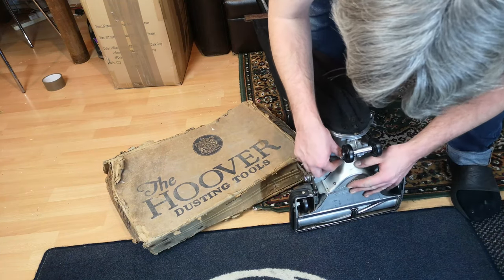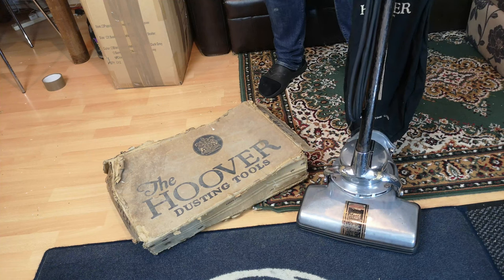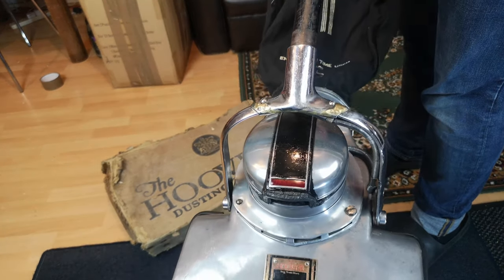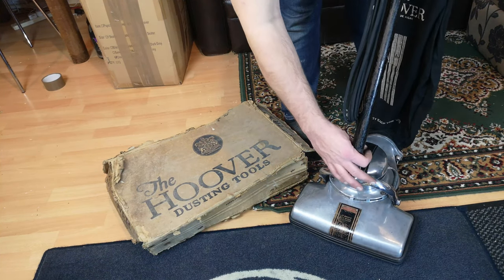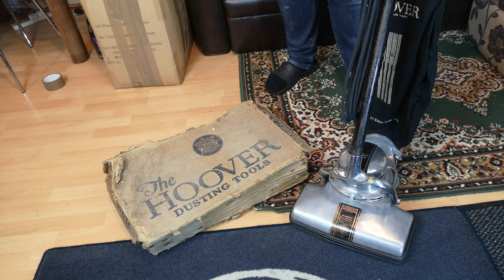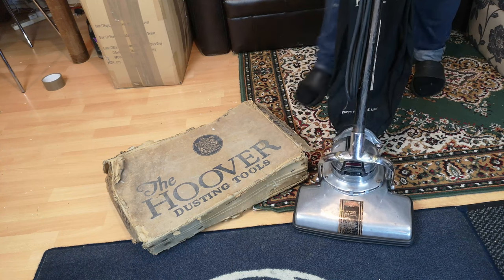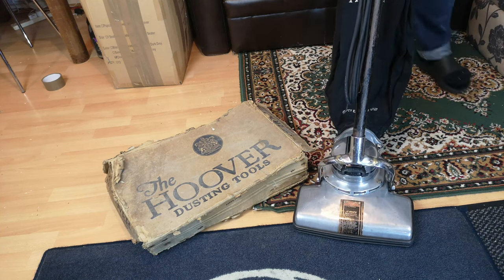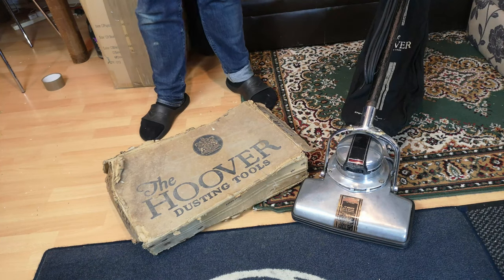I think we're going to call it there - stage one is certainly done. She works absolutely fantastically. What we might do quickly is take that nice new belt off so it doesn't double stretch while we store this machine - always do that folks, especially with these round belts, they snap so easily. Things left to do: we shall see this again once I've painted the handle and got it truly good. I did paint this top piece - not well as you can see, but it certainly made it back again. So the handle will get roughly the same treatment: rub that down, clean that up, find the rubber bush that should sit in there to stop it from shorting out, and this will be done. I hope you like it - I hope you think it's as pretty as I do. We've got three coffee cans in fact - this makes two of them done, this and the 875. So two down, one to go. I hope you have enjoyed and this very old vintage Hoover will see you soon, bye bye.